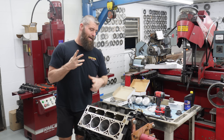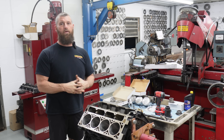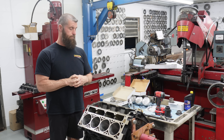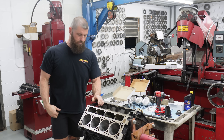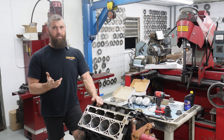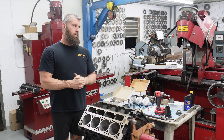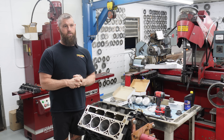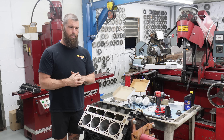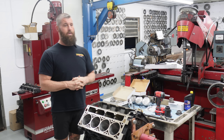So I was very surprised. Personally, I've only used three, four, or five Rollmaster timing sets and only in small block Chevrolets. It's been a really long time. Mostly, especially on the LSs, we use SA Gear or Dyna Gear - it's the same company. They've got a really nice billet set and we've used them for eight or nine years with zero failures. They make a double and a single, but we pretty much just use singles unless it's some crazy solid roller build.